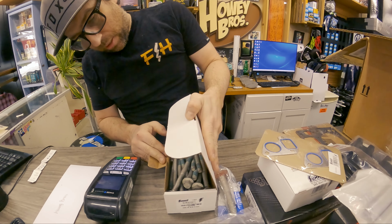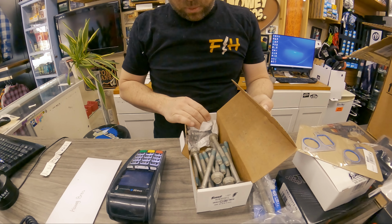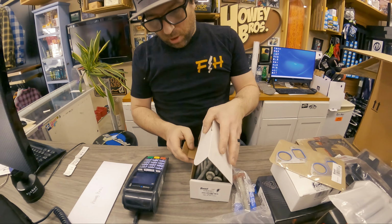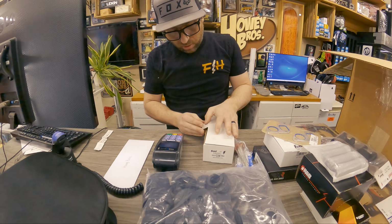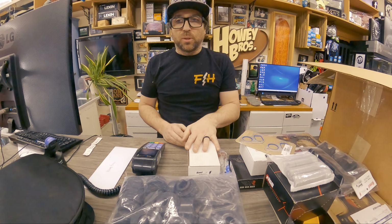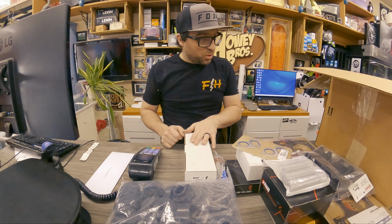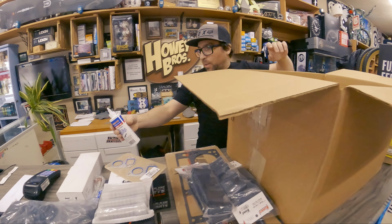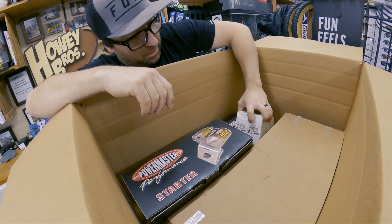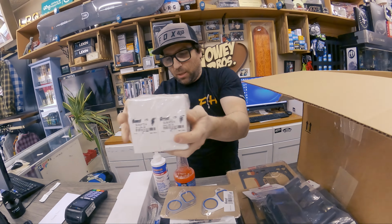These are all our new bolts, so all new head bolts. Once again, a lot of head bolts are what they call stretch to fit, so you can't reuse them once they've been taken out of the engine. So those will go in. Some assembly lube, because it's always better with lube. These are our lifters. I'm not gonna take them out, I'm just gonna leave them in there.